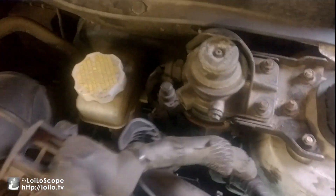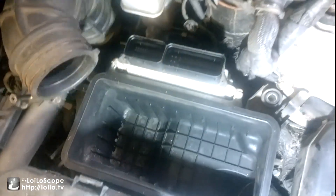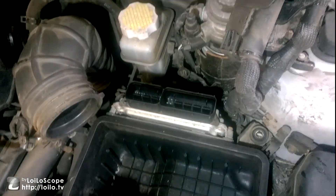These are the pins. The front one — pull it out this way and pull it up. Then the one that's closest to the passenger side is this style clip — you pull that back and then pull it up. The airbox will be clear to come out now. Then I'll show you in the next clip how to disconnect the pipes.